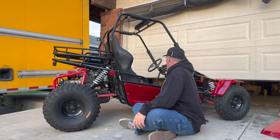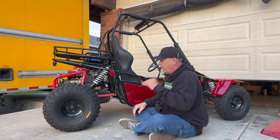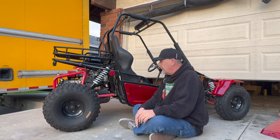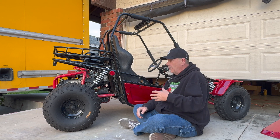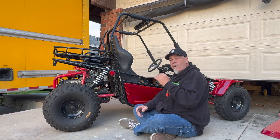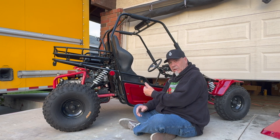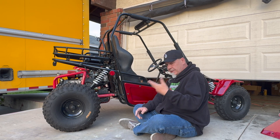Start it up — okay, it is holding a charge. It was running at about 14.5 to 15 volts when it was running right there. Hopefully that'll work out. The issues I had were it cutting out at a higher RPM — I don't know if it was charging too much or not. So first thing is change the ignition coil, and then we move on to the regulator and so on.